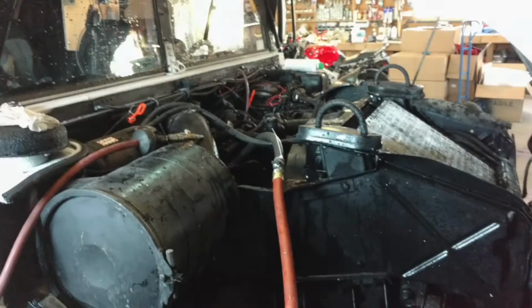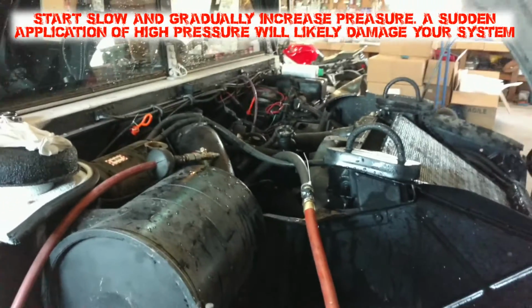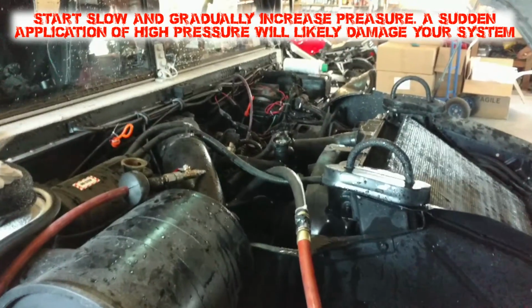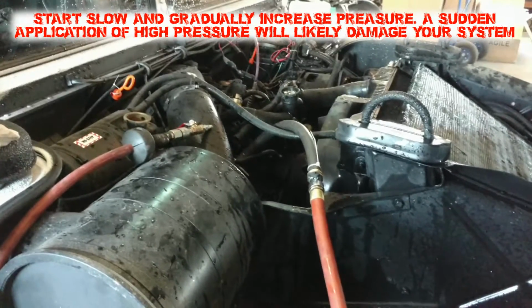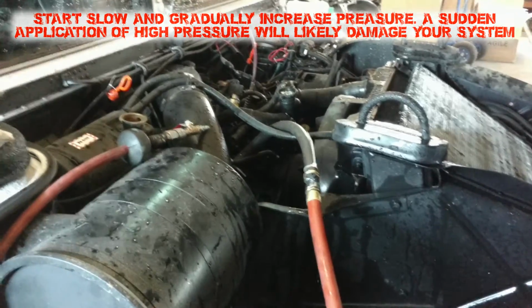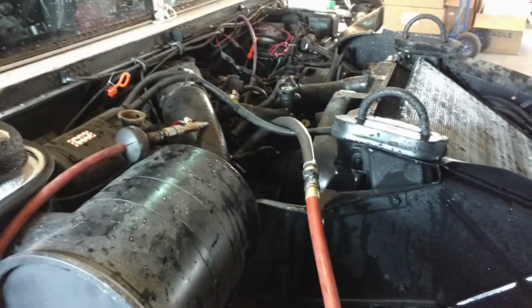So I ended up cycling between water and air pressure at the very least a dozen times, maybe 2. And what I found is after purging the system with air, the initial water to run through the system and come out would pull out more sediment. So I kept doing that over and over till I got to a point where it wasn't making much of a difference and it was coming out pretty close to clear.